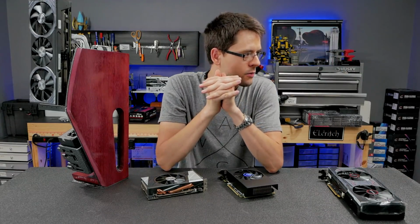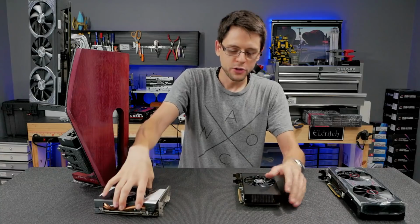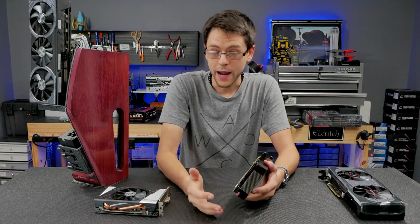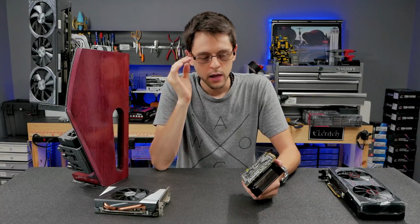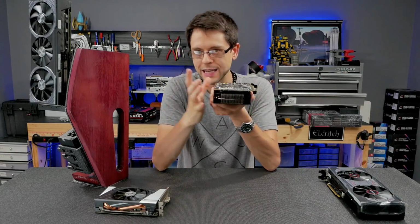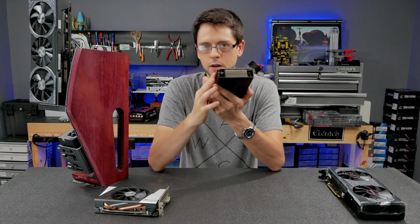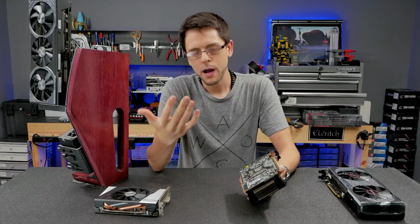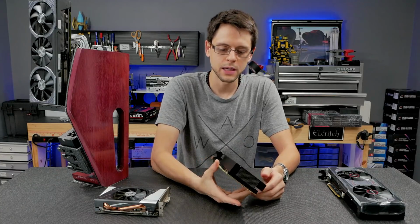Now, there's some questions about 1080 versus the Vega Nano in a Mini. So why would you want to put this graphics card in if the 1080 is a little bit better and it's going to run presumably quieter because it's going to be less power hungry, and it would definitely run off the HDPLEX 400? Well, there's two reasons. One, the Zotac is not going to fit. It's an oversized card, so it will not physically fit with the AC/DC HDPLEX 400. And two, the biggie, the power connectors are on the side, so you couldn't plug it in anyway. But all things equal, you'd probably want to go with the 1080, unless you have very real reasons for using an AMD GPU.